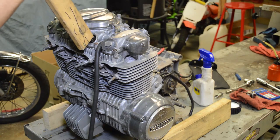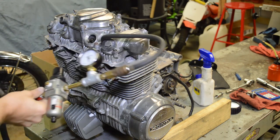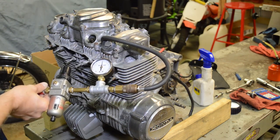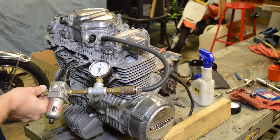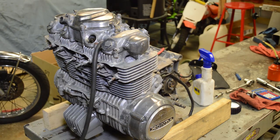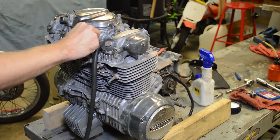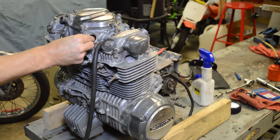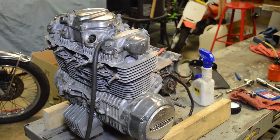And you just want to give it a couple light taps. And all of a sudden our number jumped up to 15. So we went from 12 to 15. So that's good news because now it tells me that it is just junk. And also this valve is loose. Hear that? So that tells me there's valve lash, meaning this cam is not holding the valve open.